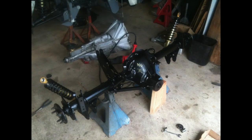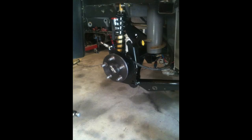And while all this was going on, Tony Vallelli, a.k.a. Captain Electron, was reworking the rear axle assembly out of a 5-liter Mustang that would replace the original one that had been bent up. We found a couple of new shocks from actually Dave's neighbor, a couple of houses down, who built a Factory Five project, and he had a couple of shocks left over. So we used those, and we also installed a set of new axle shafts as well as new bearings and seals, and also replaced everything in the differential as well.